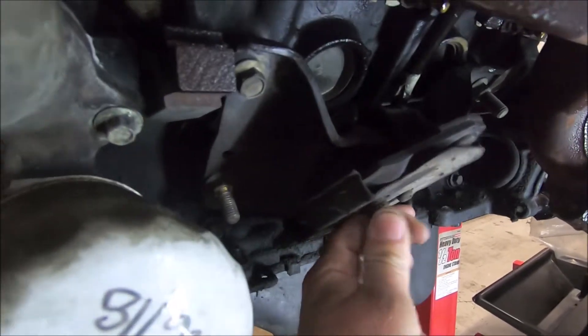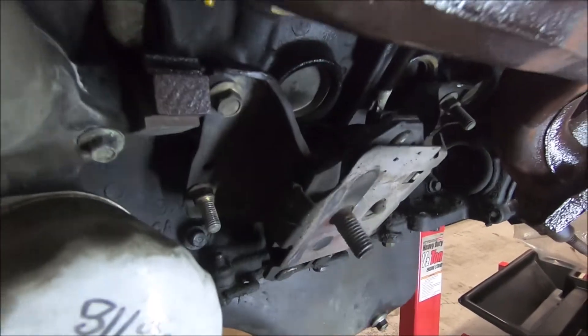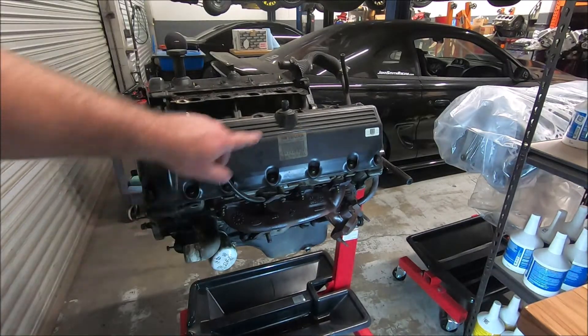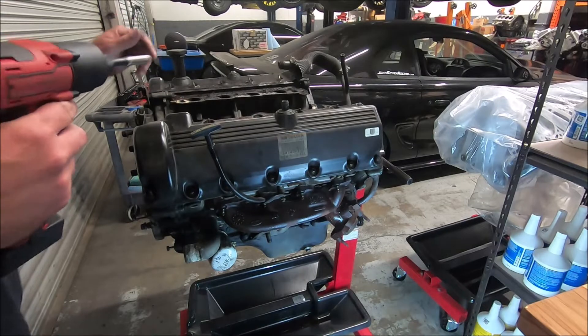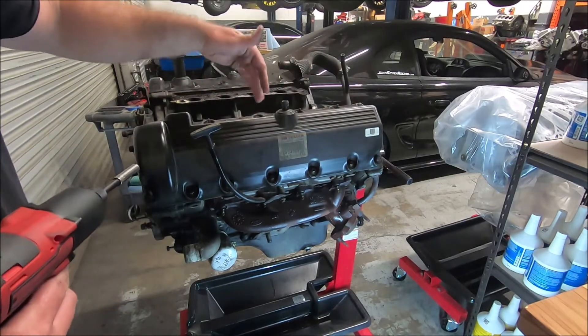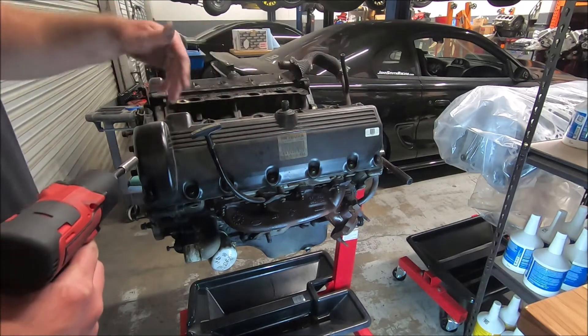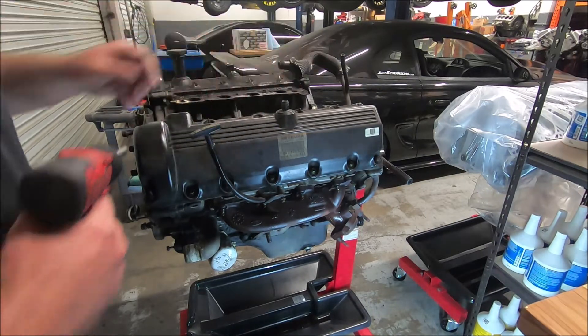I think there's a little bit of rubber left on the inside of this one. I'm going to loosen the dipstick tube. Now we can take this valve cover off and take a look at what's underneath there. Whenever you do anything like this, when you bolt it down, it's a good idea to bolt it from the inside out. And when you take it apart, you unbolt it from the outside and work your way in.